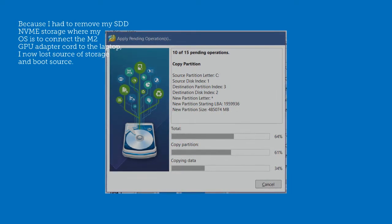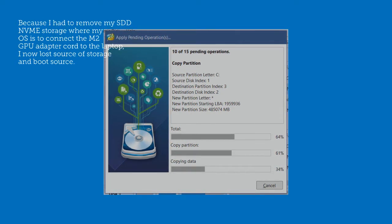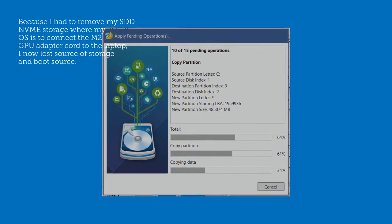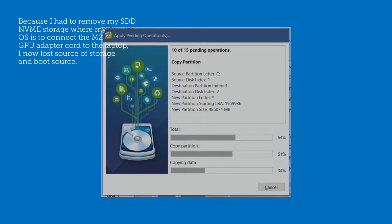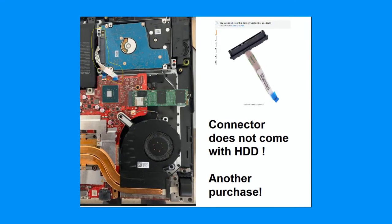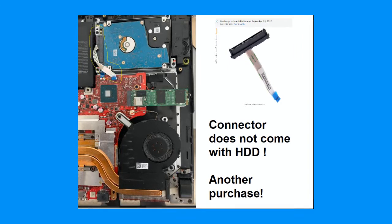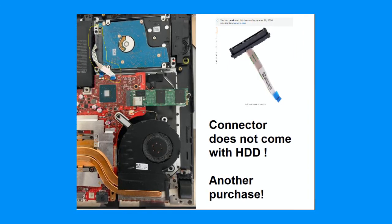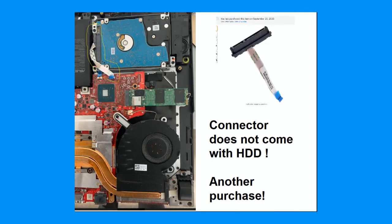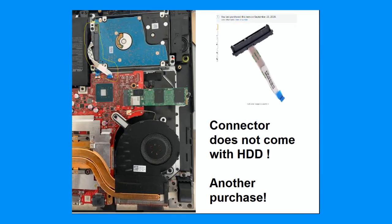Because I had lost my OS drive — that's where my C drive sat on that SSD — I had to move all my data and my OS to the HDD, which my laptop did not come with, which meant manipulating it and doing some partition shifts. Because I had to install the OS on the HDD, which was bought to replace the SSD being taken out, there was a lot of physical tinkering involved. I bought an HDD and it didn't come with the connector to the motherboard, and getting in the blue input tip of the HDD connector was another pain point.